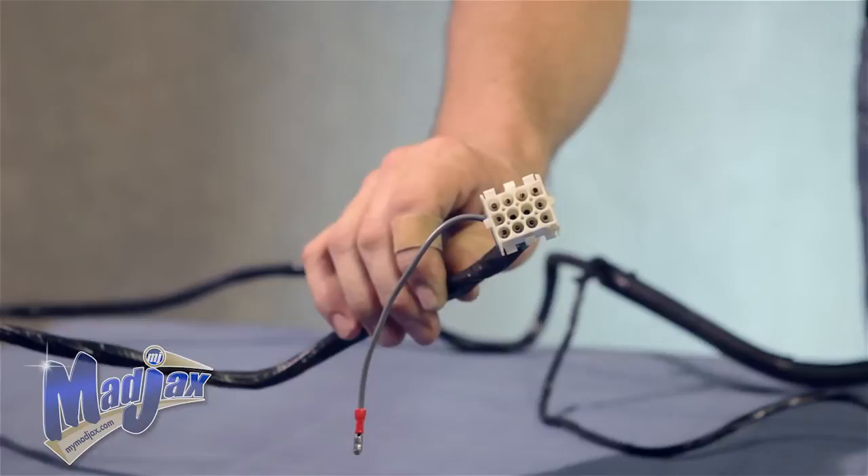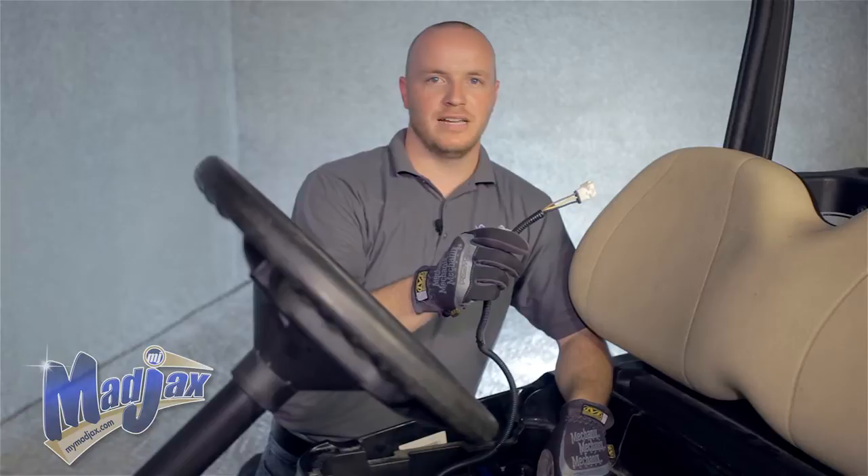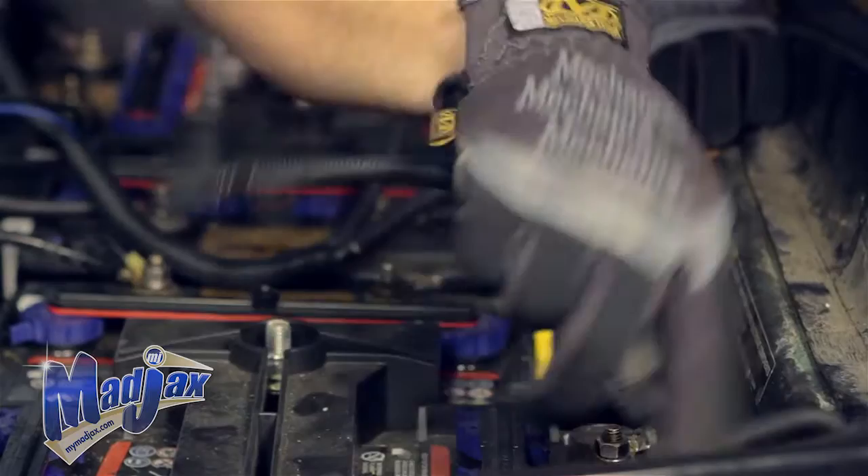Last, we have a 12 pin connector which runs all the way to your front dash and plugs into your Club Car factory harness. Now let's get started. To begin, we're going to run our tail light wires through our body. Remember that the yellow wire is for the passenger side. You can use a wire snake and retrieve your tail light harness when you cut out for your tail light hole.